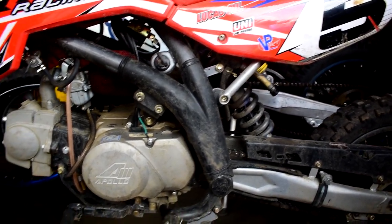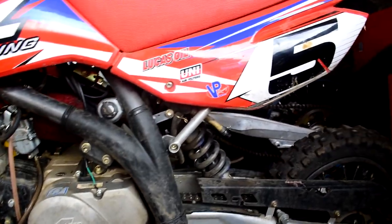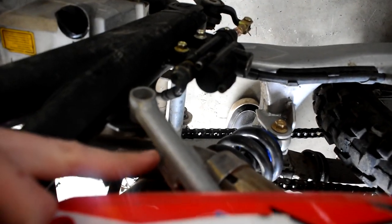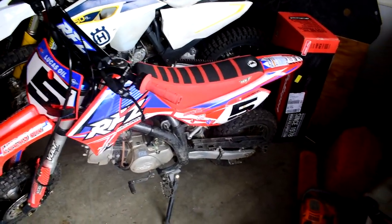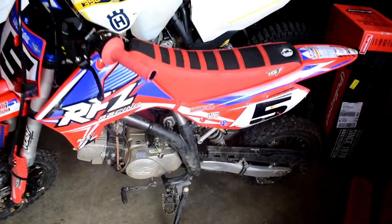The next thing is losing exhaust bolts. I've lost this bolt right here — it's a custom bolt I had to put in because on the other side there's a weld on the nut and the nut had broken off. There was a really poor weld on the nut, it broke off, the bolt backed out, and then my exhaust was rattling down the trail.